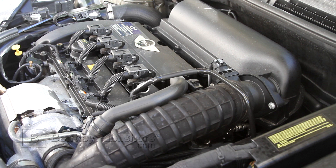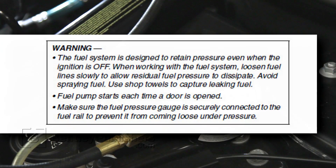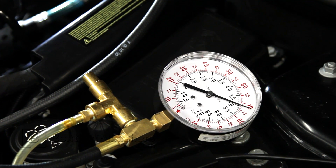In order to complete the diagnosis, we're going to have to test the in-tank fuel pump. Using your Bentley repair manual, locate the fuel delivery line and tap in with your fuel pressure gauge. With my fuel pressure gauge tapped in between the in-tank fuel pump and the high-pressure fuel pump, I'm going to monitor fuel delivery pressure. With the symptom present, fuel delivery pressure is 5 bar. The next step is to confirm that it holds 5 bar for 15 minutes. Our vehicle held 5 bar for 15 minutes, confirming that the in-tank fuel pump is operating normally.